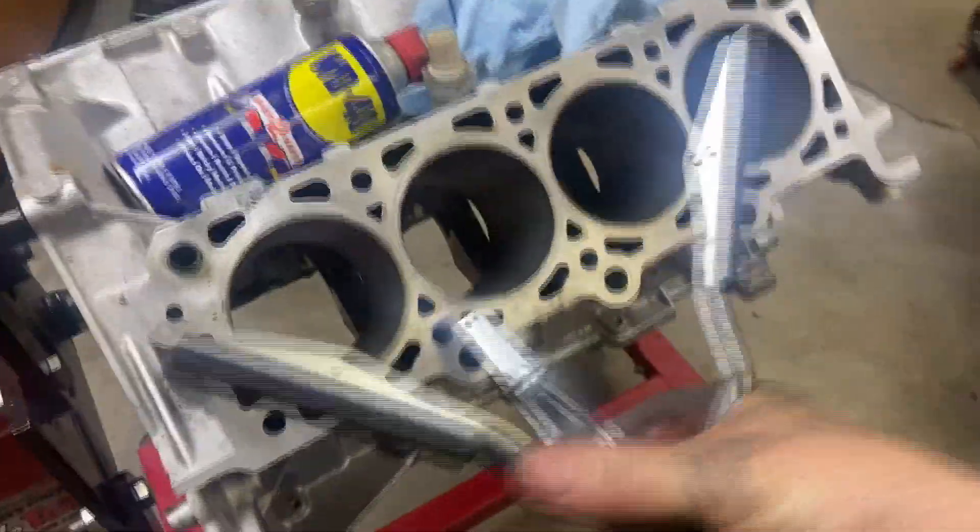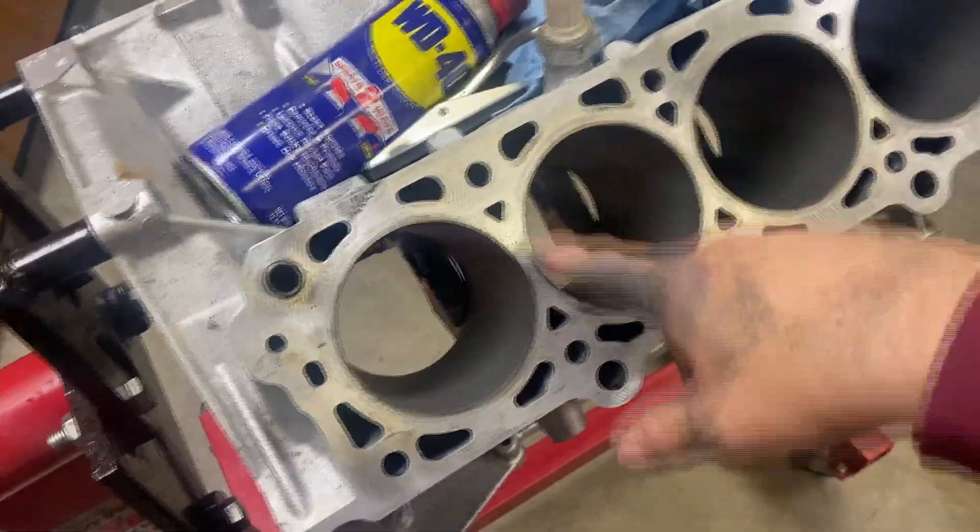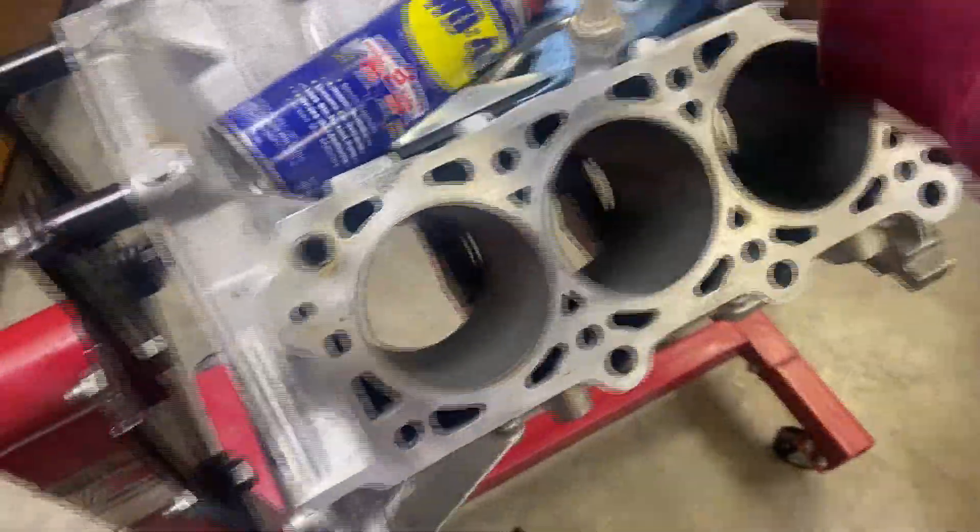I also used a rigid hone — the type with flat stones. The reason is that if there are any abnormalities, the flat stones will make them stand out and reveal pits clearly, whereas the flex hone tends to conform and fill in all the areas. After using the 1000-grit sandpaper followed by this rigid hone, the surface is just perfect. Thanks for joining me in this video. On the next one we'll see if we can salvage the pistons, take measurements on the block, evaluate the heads, and probably start tearing those down. If you like this video, please like, subscribe, and click the notification bell.